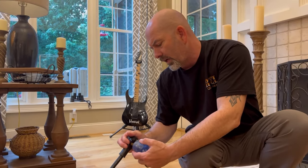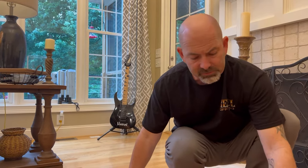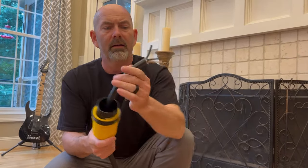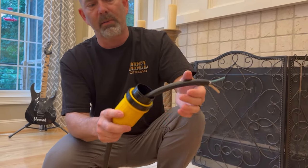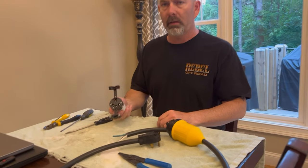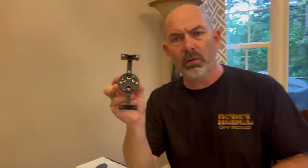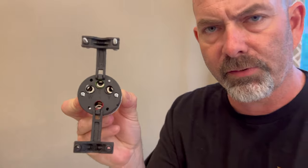For the generator I ordered a 10-foot cable like this and measured it out. I've cut it already, stripped the main wire, and have the three wires exposed. I've placed this connector on so I can go ahead and wire this up. I'm going to show you how to wire this up and then we'll go put it on the rescue wagon and see how it works. This end will eventually connect up inside — it's got four holes and I only have three wires, so I'll show you how to wire that correctly.